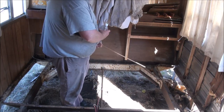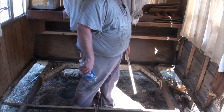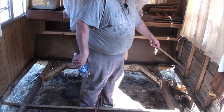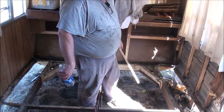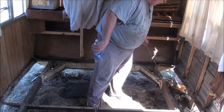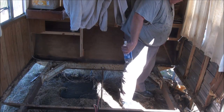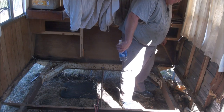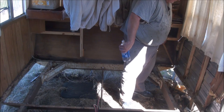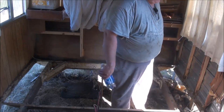So all the structure in this thing is made out of 2x2s. Crappy 2x2s, not even good 2x2s. All the studs, that almost looks like 16-inch centers. But there was a 2x2 across here, so there's a gusset going out to the corner here. And you know, the gusset doesn't even go all the way. Only about half of this corner 2x2 sits on it. But this wall sits on a 2x2 between this gusset and back here at the door. It's a pretty long span, I think.